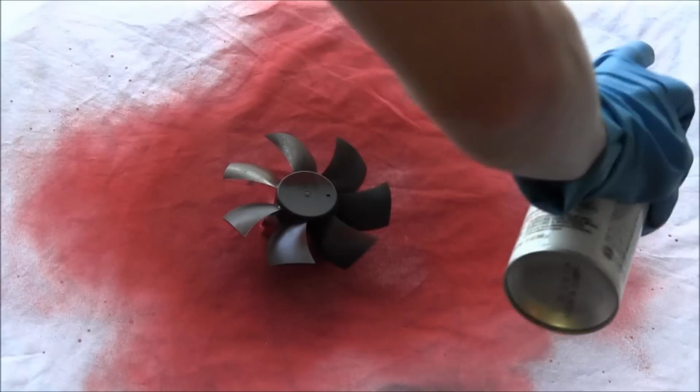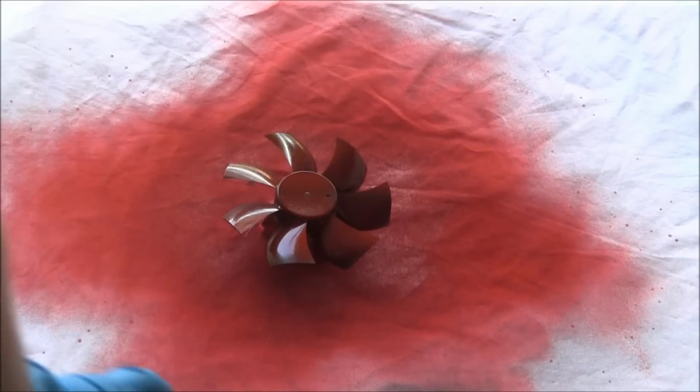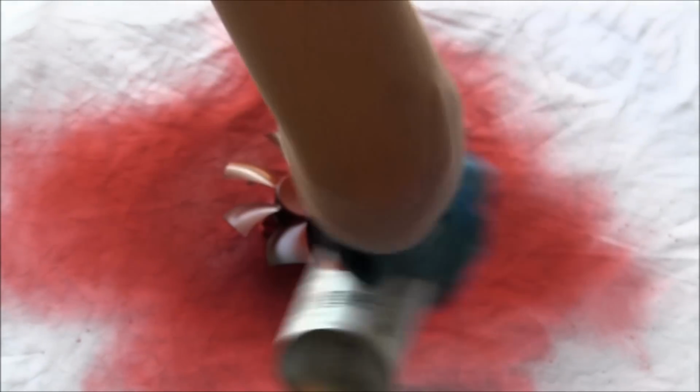When it is time to go ahead and paint the actual fan blade and or shroud itself, make sure first you choose an open and ventilated area so you can keep paint exposure as well as dust buildup to a minimum. A trick I used throughout the painting process was a little outdoor fan on a low setting to blow air across the top of what I was painting while I was painting to keep the air moving, not allowing any dust or debris to settle in.